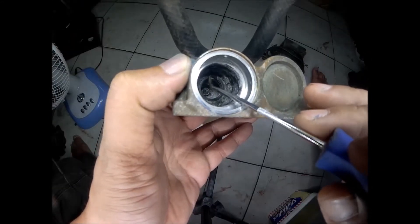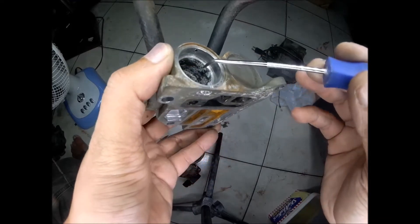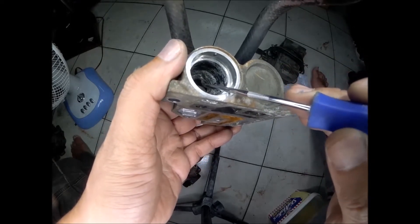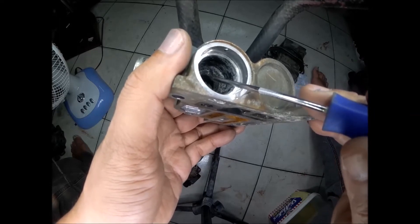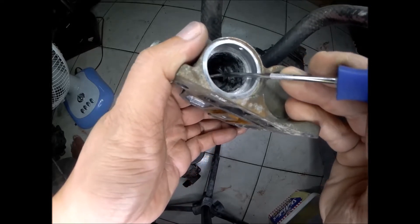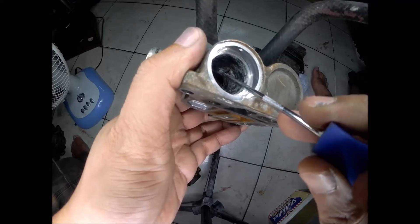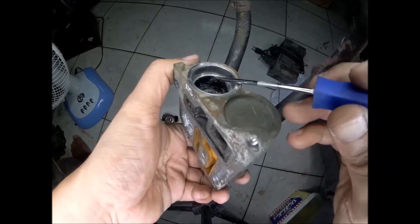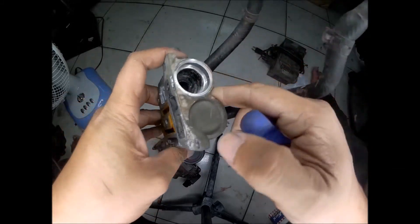With the light, you can now better see the inside of this idle valve. It's very dirty — still black colored even after cleaning with the car cleaner. You can see that the rubber is already broken and the adhesion is already lost due to corrosion. You can see the other part of the rubber still adhered to the aluminum housing, but the rubber is already broken with clear signs of corrosion underneath. This idle valve cannot be used anymore; we need a replacement since the seat is broken due to corrosion.